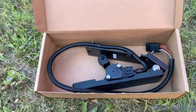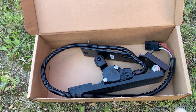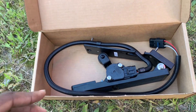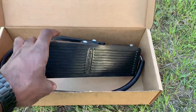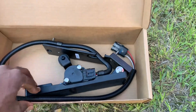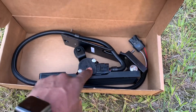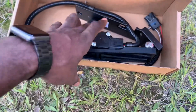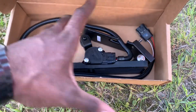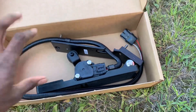All right y'all, so we're changing out the throttle pedal on Big Daddy - a '99 Freightliner classic. You might be asking why would you want to change out your gas pedal, your throttle. The reason is because of this sensor right here - your throttle position sensor that comes on the pedal. You can't actually order the sensor itself, you have to order the whole assembly. So that's pretty much where I'm at.